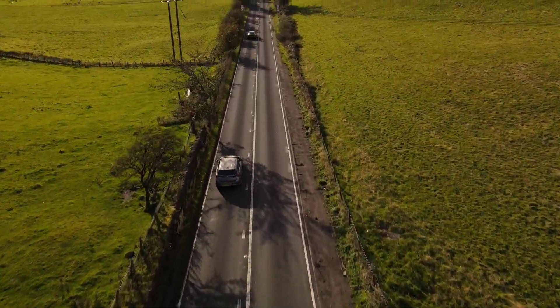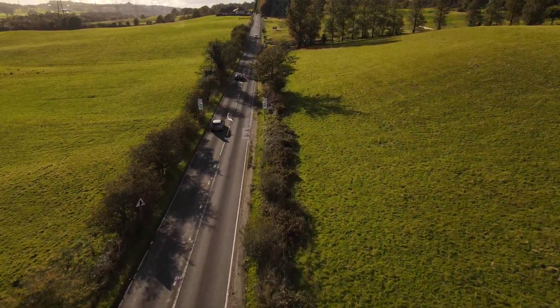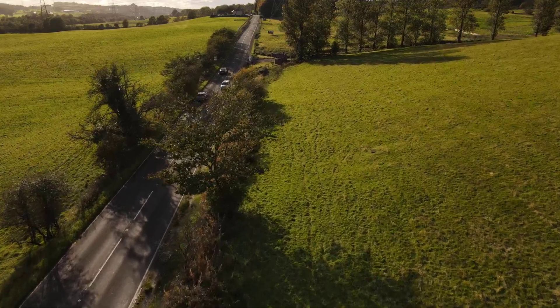This is also a good opportunity to have a play with some of the electrics. There are no notorious problems when it comes to electrics on GTRs, but just the usual stuff: make sure the aircon's blowing cold, make sure the radio works, listen to those speakers we already spoke about. Although there's a lot of chat about these gearboxes being quite noisy and uncouth, they are actually very smooth. So if you're driving and you're feeling like it's going into gear really jerky or violently, something's not right. In auto with a bit of throttle, there should be no crunching, no jerking as you're going through those gears — and that's the way it should be, even on these early CBA cars.